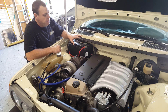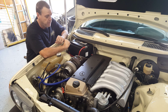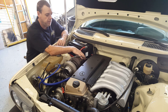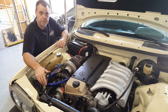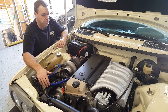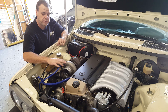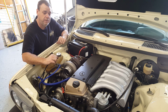Here's the plan of action. To get to the exhaust manifold, everything over here pretty much needs to come out. I'm going to start with the battery and the battery tray, and from there I can reach the V-band on my downpipe — it's hard to reach from the bottom, about the height of the frame rail, so it's easiest to remove the battery and tray first, then take the downpipe off. From there I'll remove the charge pipes — I've got two of them, one between the turbos and one to the intercooler. Down towards the intercooler is already disconnected, and the turbo drain lines have also been disconnected. Once the charge pipes are out, I can remove the low pressure turbo, which is the bigger one, and then the high pressure turbo, and finally the stock manifold.